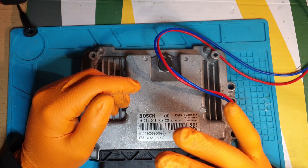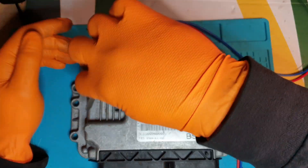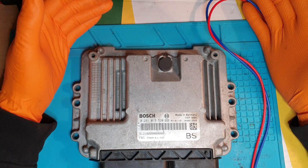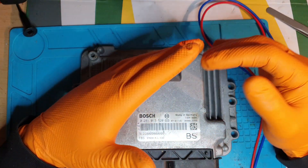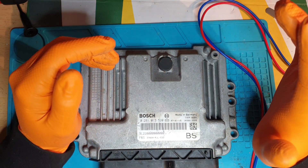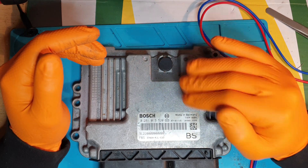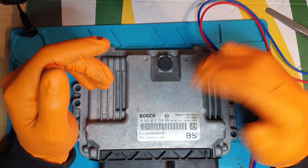Which is not clever. Usually if they'd used 12 volts on this ECU they probably would have been all right. CAN bus is extremely resilient — it can get shorted to battery positive or battery earth and it doesn't matter. As soon as you take that short away from it the CAN will just recover. It's extremely resilient and extremely good at what it does. However, if you put more than double its rated voltage down the CAN line, that's where bad things happen, especially on an ECU that's only rated for 14 volts maximum, probably 16 volts.